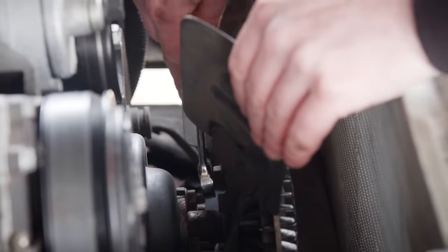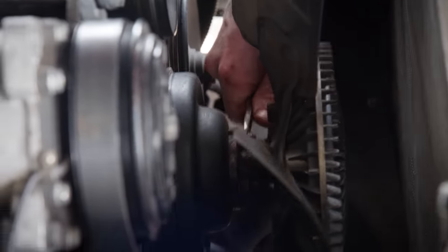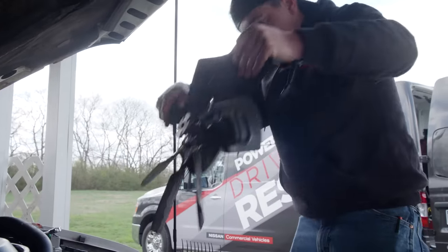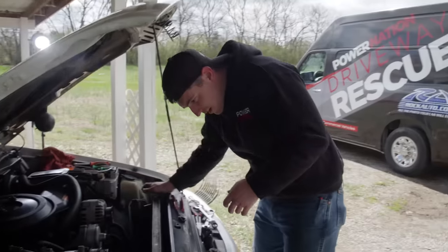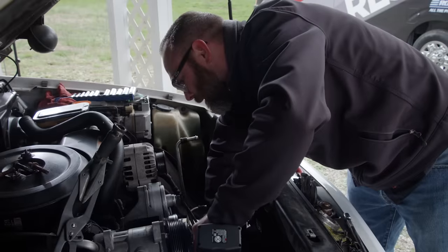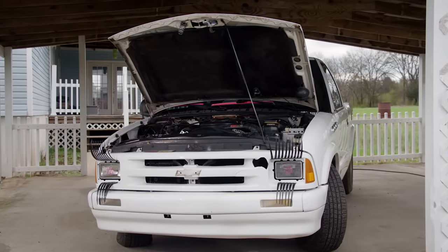That hose is soft. We'll look for the space between the two blades — it's a little bigger than the rest, they actually do that so you've got room to work. I'll get these broke loose and then we should be able to get them off by hand. Now that the fan and water pump pulley are loose, I'll remove the serpentine belt by relieving the tension. Now that all the lines and hoses are disconnected, we can pull the radiator out. Just a couple bolts and we'll have this water pump off. The seal doesn't look good and there's white residue here where the coolant came out of the weep hole.